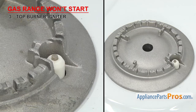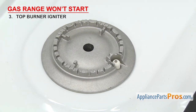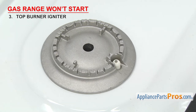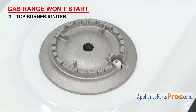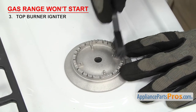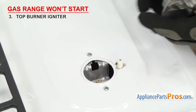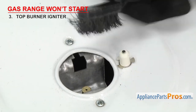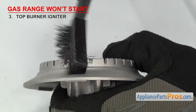If you hear the igniters clicking but the stove top burners on your gas range won't start, it could be that the top burner igniter has failed. The fact that the igniters are clicking usually means that the spark module and switches are okay. In most cases, the burner head and igniter just need to be cleaned. Make sure that all the gas ports are clean, especially the ones by the igniter, as these let the gas out to be ignited. Make sure the igniter tip is clean, as well as the area right in front of the igniter tip on the burner head. If it's rusted or dirty, the spark may not jump across.